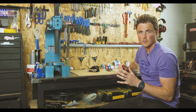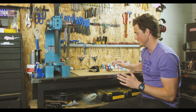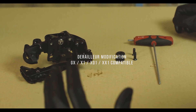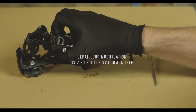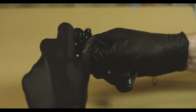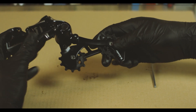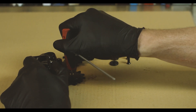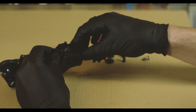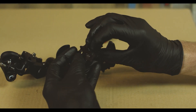Now we're going to upgrade our 11-speed derailleur and make it 12-speed compatible. All you'll need is a 3mm Allen wrench and the spacers and bolts provided in your E13 12-speed upgrade kit. We have the derailleur pulled completely from the bike with the cable removed. Our first step is to push the cage forward and lock it in place — this gives us easier access to the pulley bolts. Now we're going to pull the 3mm bolt on the upper pulley. When removing the pulley, be careful not to lose the back plate — if you pull the cage first you can get them both out clean.